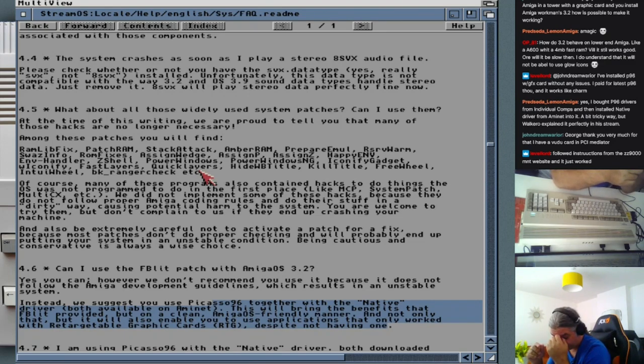But if you have on that Amiga 600 the Kickstart 3.2, that will benefit because you will not lose RAM while the AmigaOS boots. If you have 3.1 or 3.14, things that it expects to find on the Kickstart ROMs, it will need to load them from the hard disk and load them inside the memory of the machine. So if you want to keep as much memory as possible on that machine, I would recommend to use Kickstart 3.2 ROMs as well. Now, if it is going to be fast, if you use the black and white icons, not the glow icons, like you were doing before, it will be the same. But I haven't tried that on this kind of machine.